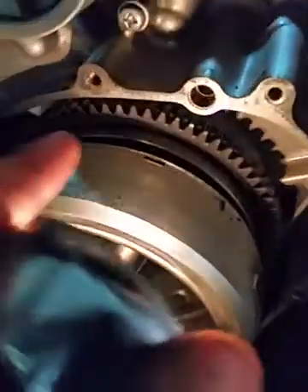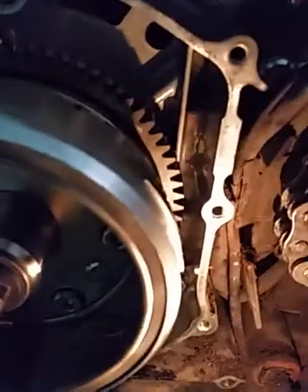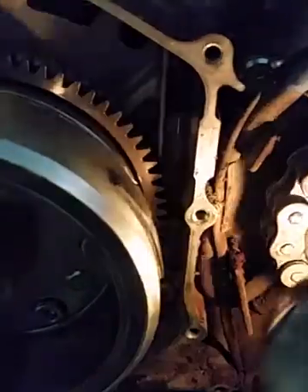The wire has to hang down from the stator — I already took it apart. Then you start unscrewing the bolts. I started from this one and go right down, and I put them in order because it turns out two of them are longer. They're over here, about where the sprocket cover is — this one and this one are longer.